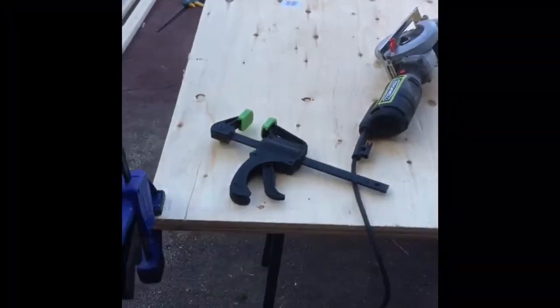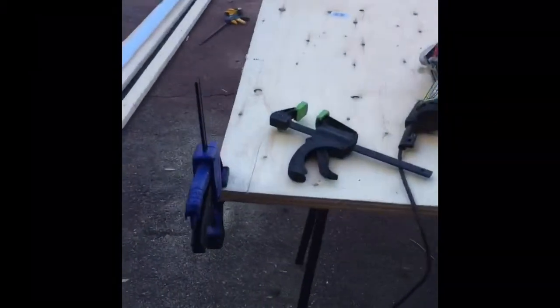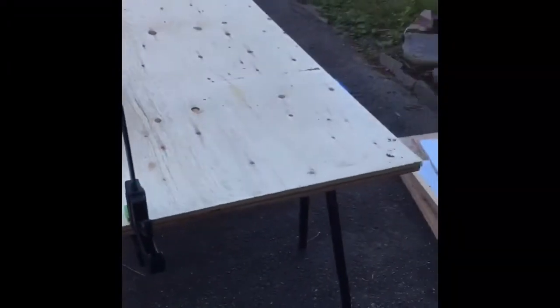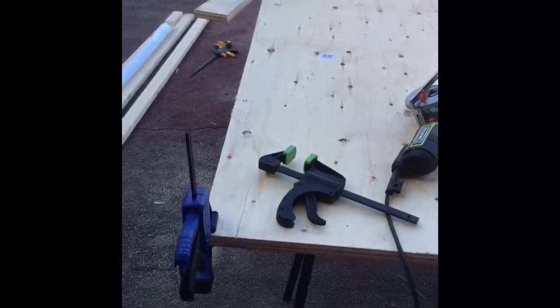It's another beautiful September day here in Mount Albert, Ontario. We've made the cut for the walls — fairly simple. Just clamped the two quarter-inch pieces of plywood together so they would have identical cuts. We're doing this as simple as possible because it's the first build, and also for cost — keeping it cheap where we can, using angle iron for corners versus typical RV trim which is pretty expensive.